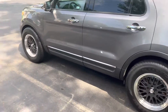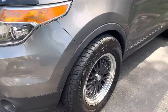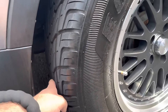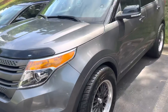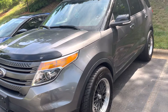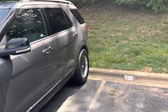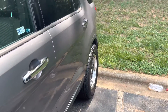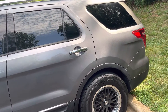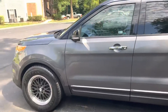Wheels and tires are probably the biggest plus on this one. I get quite a few comments on the fitment. They do fit — there was initially a little bit of rubbing on the front inner portion of the subframe mount back in the corner, but honestly it's only one spot. As you turn, if you're backing up and cut it, you'll feel it catch and then it kind of goes away. No marks or rubber damage coming from the wheel or tire. The rears obviously fit the same — no rubbing. Being two-wheel drive, if you hit a hard enough bump or a depression in the road, you can feel it rub a little bit, and it does sit a little higher in the back than in the front.